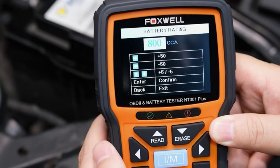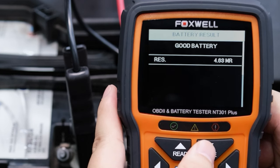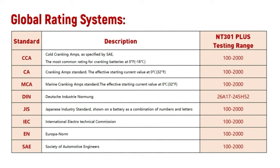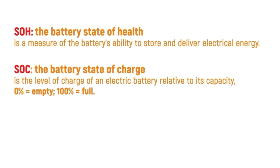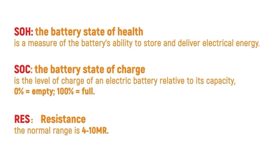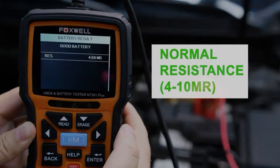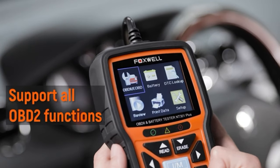The tester runs automatically and displays the results: 12.68 volts, current value 786 CCA, SOH 82%, SOC 100%, resistance 4.63 milliohms — indicating the battery is in good condition. SOH means the health of the battery, SOC means the state of charge, and resistance represents internal resistance. The normal resistance value range is 4 to 10 milliohms; if it exceeds the normal range, the larger the value the worse the battery performs.